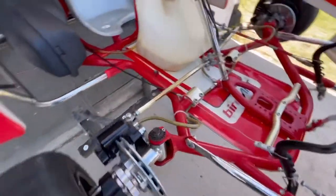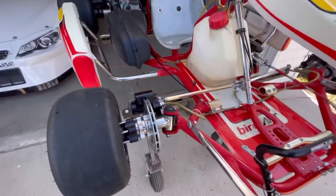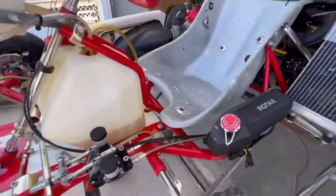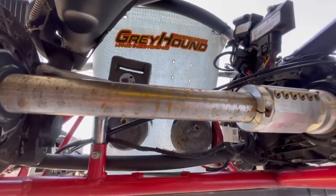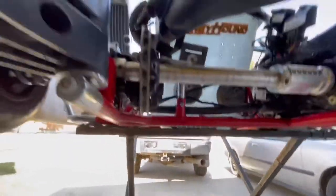As well, we have no options for really crossweight or corner balancing because no suspension. So all we can really do is move lead around. So we got to weigh 397. I only have to add about 10 pounds of weight. This cart has about 40 just on the seat. So we'll pull most of that stuff off. You can see all that lead up there. Otherwise, it'll be a freaking rock going around the track.